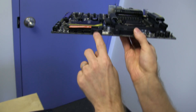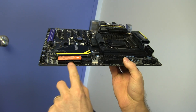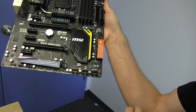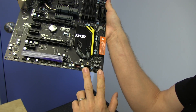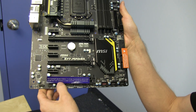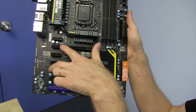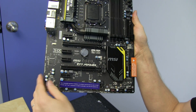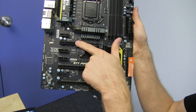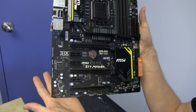There's your post-debug LED — again, this is my new favorite location for this. The onboard USB 3 header is at a right angle on the right-hand edge of the board — perfect. SATA 3, 6 gigabit per second. Four SATA 2, 3 gigabit per second ports. There's your multi-BIOS switch to switch between the two physical BIOS chips. A couple front USB 2 headers — normal ones — and a high-powered one for charging things like an iPad. Due to bandwidth allocation limitations, you want to use an Ivy Bridge processor if you're going to use the bottom slot; otherwise these run at PCIe 2 8x/8x with Sandy Bridge, or PCIe 3 8x/8x with Ivy Bridge. It's a fully PCIe board with four PCIe 1x slots and three PCIe 16x slots — physically 16, 8, 8, and 4 — though that 4 runs off the chipset. So basically this is a dual-card board.